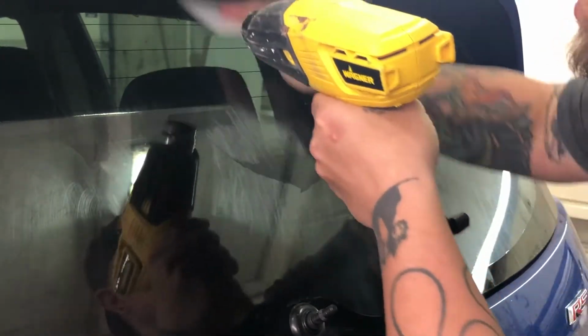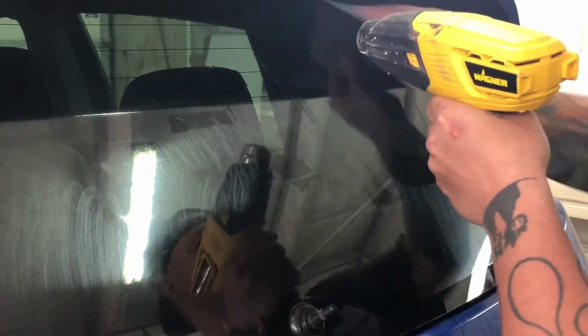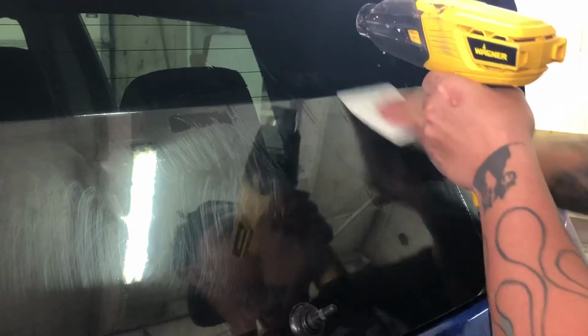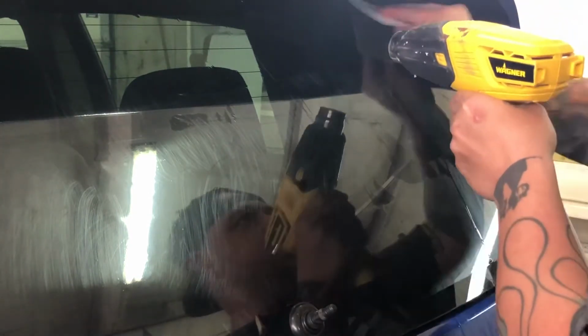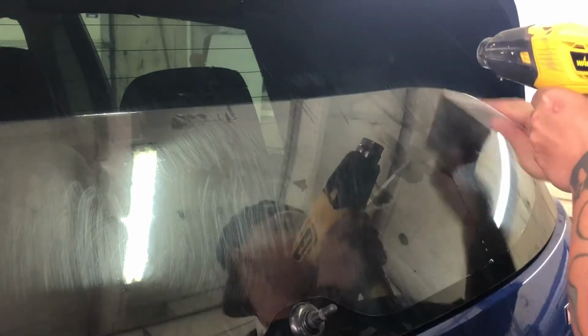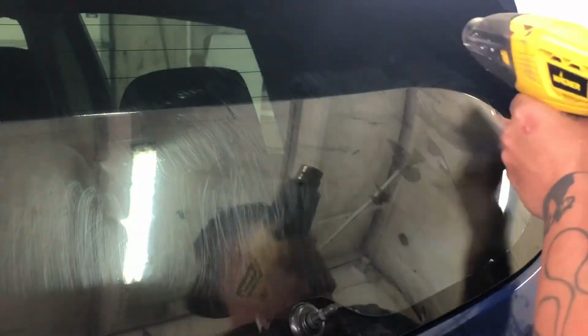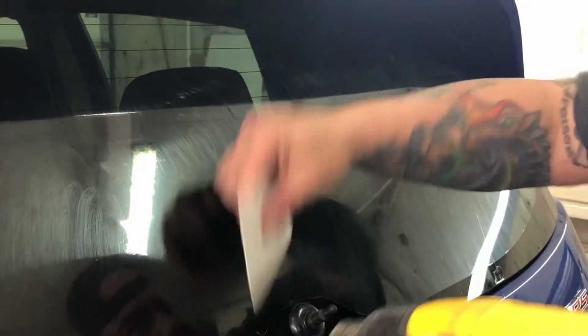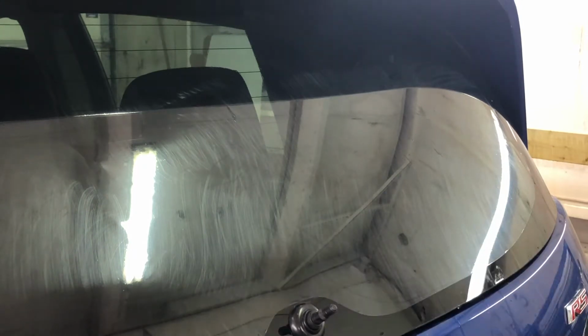Most of these patterns, if you're hand cutting patterns, chances are you're gonna overcut them just a hair, so you should make yourself space for that particular issue. And it's gonna happen now and then when you're shrinking back glasses that you're possibly gonna slightly burn the edges. It's okay. Nib that stuff off. When I say nib it off, I'm gonna show you, and I'm gonna zoom in on what I'm talking about nibbing off.